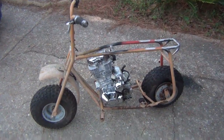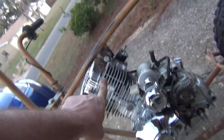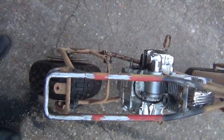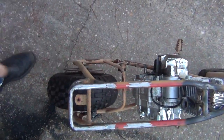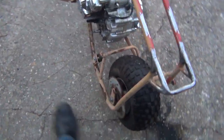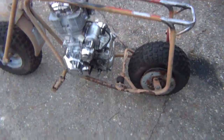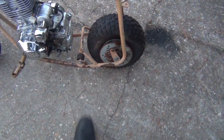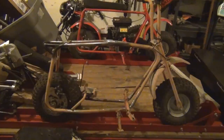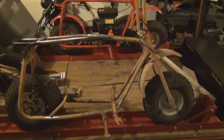I did a little welding and fab today. I got the top headstay put in there and got the chain alignment good — those two should go between those two sprockets. I've got to come up with a custom rear sprocket to work for a 428 chain, which is what this motor up here supports. Getting rid of that number 35 little tiny chain, which I don't think is going to do the job.